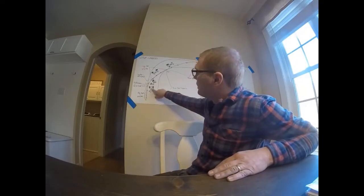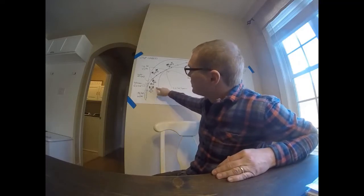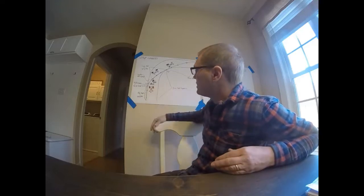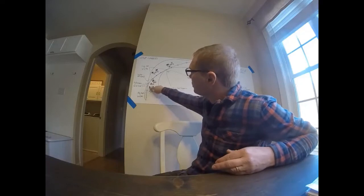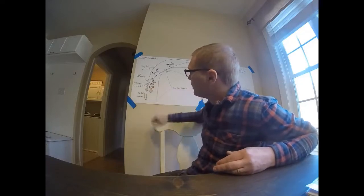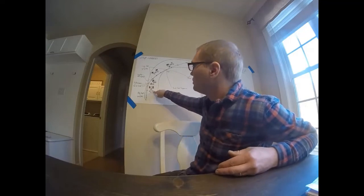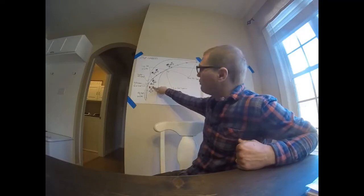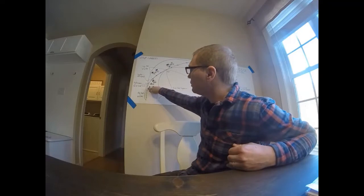Okay, in my rudimentary figures, as you can see right here, the bigger the tire, the more load that's on that tire. Red represents braking. So we really are looking at the front two tires when we're braking in a straight line. Yes, the rear has an effect, but unless something's really askew, you're going to get the biggest bang for your buck making the changes up front if you have an issue here.